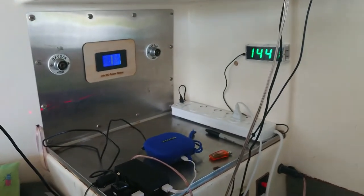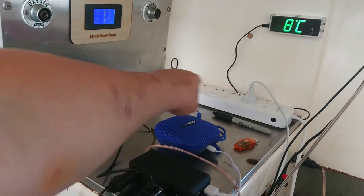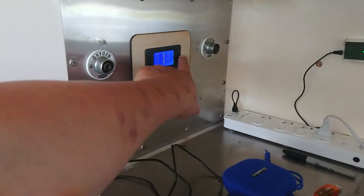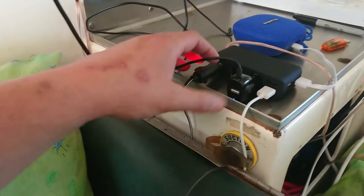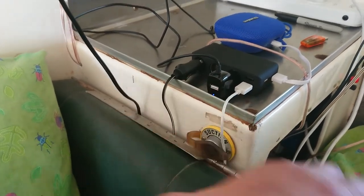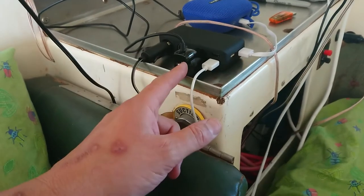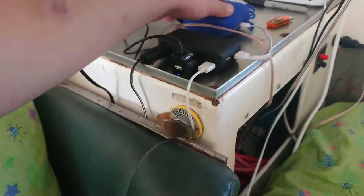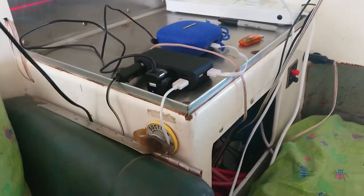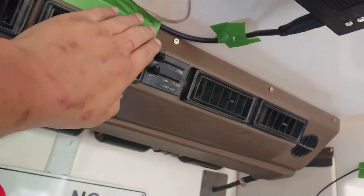It's probably a little noisy because things are hot in here. This little clock here has a backup battery, so I've connected that into the mains regulator in this power board, which is only on when the inverter's on — so when the inverter's off we're probably not camped for a long time and we probably don't care what the time is. We have this stuck down so that we can still put things in and out, but this will tend to stop them rattling loose in transit. This is the 2.5 amp one — this will go to my kids' tablet. The upper one will go to my phone. This is a fast-charge one for my wife's Samsung. And the one amp one can charge our low current stuff like our radio and the Bluetooth speaker.